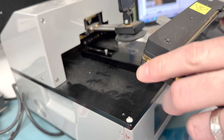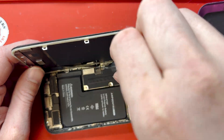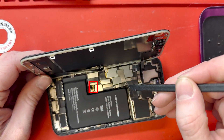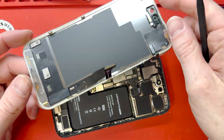Just a disclosure — you can break the screen doing this repair. Once the screen is removed, you can remove these Y000 screws in yellow to get the screen disconnected. Disconnect the battery in red, and then disconnect the screen and proximity sensor in blue here to get the screen fully removed.